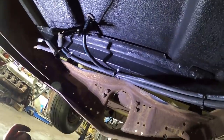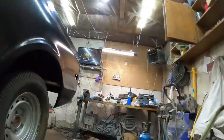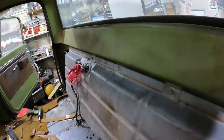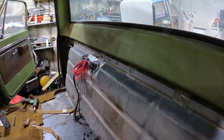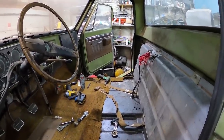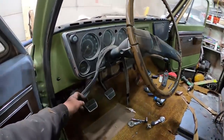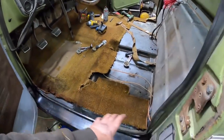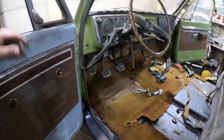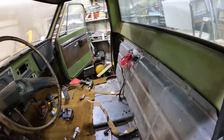I put the seal-all on the tank to be extra safe - soldered it in and the wires go through with that gooshed in there. I'll let that set and go have something to eat. Coming back out to clean up the cab, put the seat back in - the interior is kind of back together. I need to run the 12-volt wire under the carpet, then put the door seals and kick plates back on. The interior should be ready to go. It's actually a short list all of a sudden. I should double-check that the fuel tank doesn't leak, but we'll wait till crunch time.